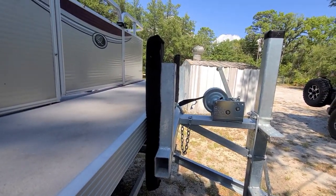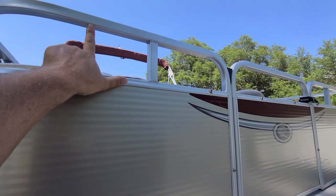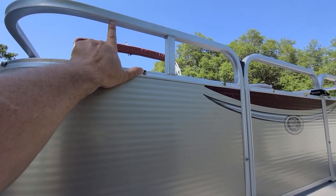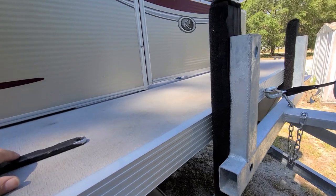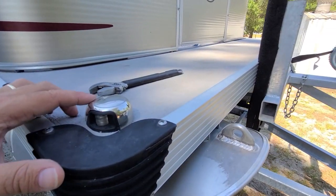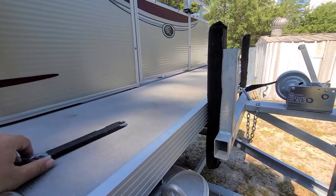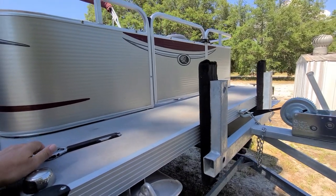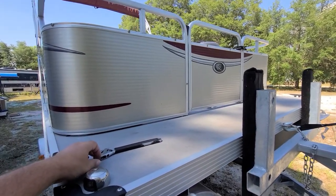Back to these lights. A lot of very seasoned boaters say don't put headlights — they're right, and I did not specify why I wanted headlights. It's basically for docking, or when you're docked, and these will be pointing downward into the water. Because at night time you don't want to use headlights — you're supposed to use your navigation lights. If you see red, they have the right of way. If you see green, you have the right of way. If you're using your headlights, you might screw up other boaters. The headlights won't be for driving like a car — it's more for parking, docking, seeing your way. I wouldn't leave them on, you'd flip them on and flip them off.